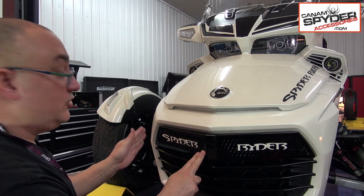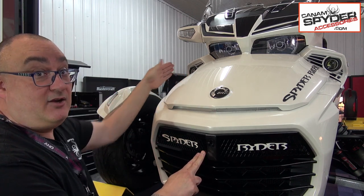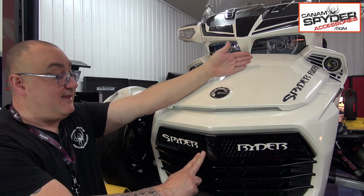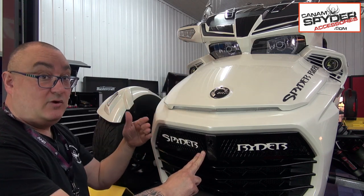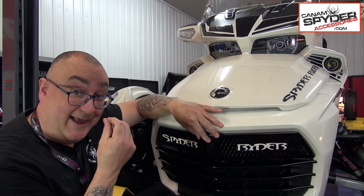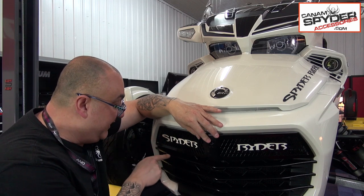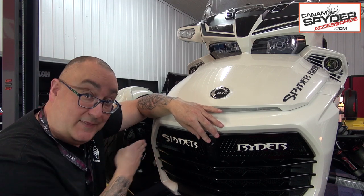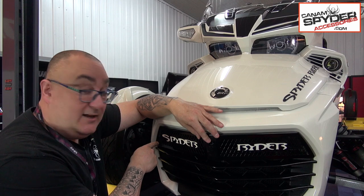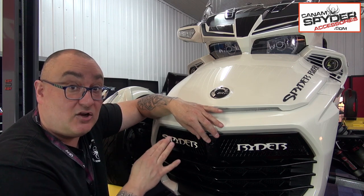You don't want that screw to go in straight from here, like in line with that headlight there. You want it to go on this angle, which is the same angle as that grill. Why? You want the screw, the head of the screw, to hit the surface on all sides of that grill. If you're going this way, it's gonna hit on this one side first, and not the whole head is gonna hit against the grill, it's not gonna look good.